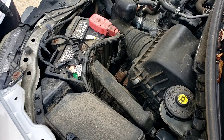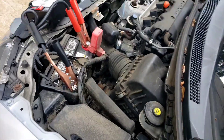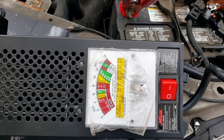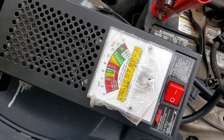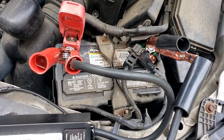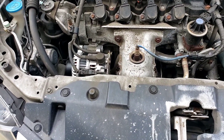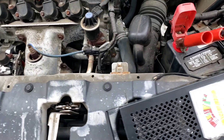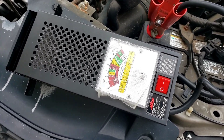Tools out of the way — let's start it up and check the charging system. Start it up, turn on the lights, and the charging is perfect. Before it was sitting at 12 volts. So yeah, the battery current sensor — that's the problem with this one. Battery checked out fine, alternator checked out fine. And thank goodness for AutoZone's no-questions-asked warranty return — you won't get that at other stores where you have to mail it back.